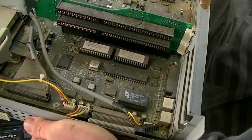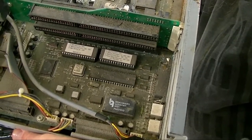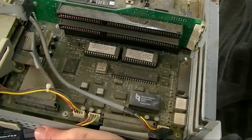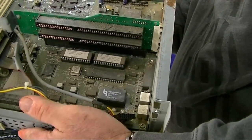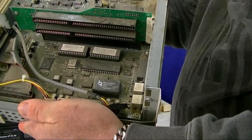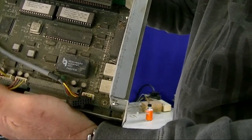But I pulled the adapters to show this other side, and what stands out is that Dallas module. In this case, it's a Benchmarq. I was trying to remember last night, did I see where you could put a CR2032 battery in there, or anything like that on the riser? And when I looked, I thought, oh, that's another of the real-time clock modules that I'll have to modify.